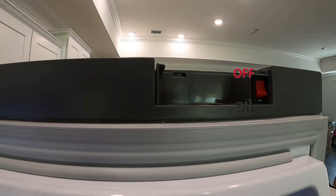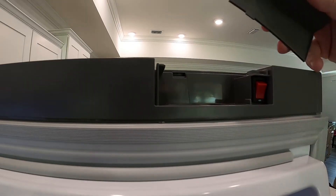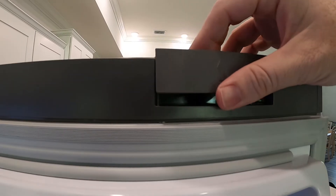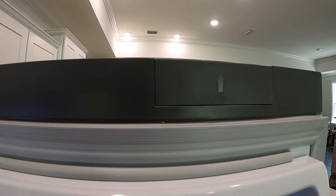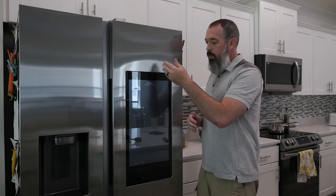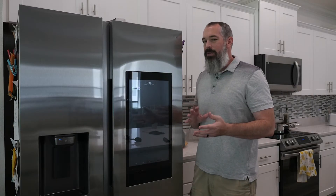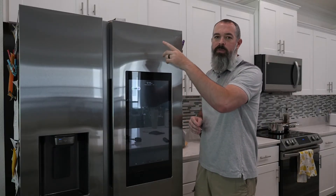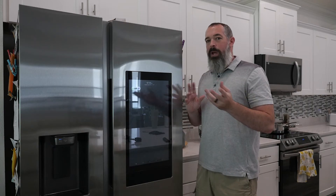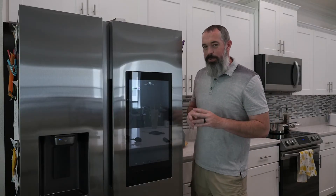It's recommended that you wait approximately two minutes before turning it back on. After the two minutes is up, press it to the down or on position using the little tab in the rear. This second option is the one I would highly recommend because you don't have to swipe the screen to access the settings menu — you're already having that issue with the screen. So it's much easier to remove that access panel, flip that switch, wait two minutes, flip it back on, and you're good to go.